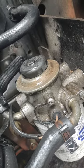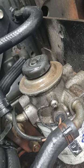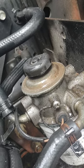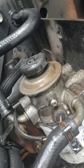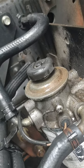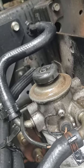So this is an Isuzu NPR. And this is the top of the fuel filter, what they would call the purge valve, where you purge out all the air when you change out the filters. If yours is doing this, and you actually observe this thing, or you think you have something that's causing it to lose power, first thing you're going to want to check is for vacuum in the fuel lines.